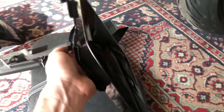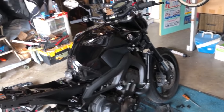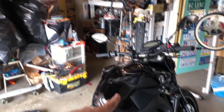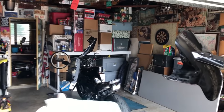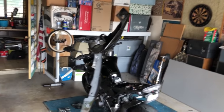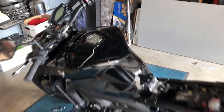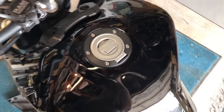Got all the dirt off them - probably wasn't the smartest idea to use a ceramic wax, but now I'm going to strip it with some prep spray so that'll chew all the wax off nice and easily. I'm going to strip all the wax off both pieces and then we'll be ready to spray. I have the plasti dip sitting in some warm water right now so hopefully it doesn't go on all orange-peely. With a little levitation I've got them all hanging in the air - I'm going to degrease them one last time and then mask off this section. I tried loosening all those bolts but there's one in the middle I don't want to risk.